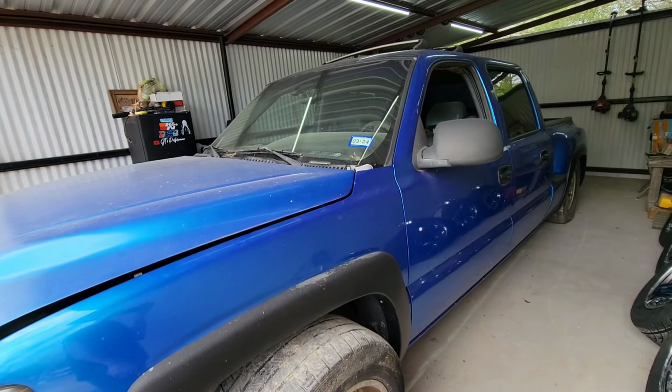Here's the brake rotor, rusted, obviously hasn't been used for a while, but not that serious damage. I think it still has brake pads in there, still good. The suspension is alright. I've replaced it before, but I'm pretty sure there are some old pieces that need to be replaced, especially the shocks. The spindles, these are drop spindles, so I'll leave the links for these. These are for the 4-bolt, obviously, for 8 lugs, not the 3-bolt for 6 lugs.